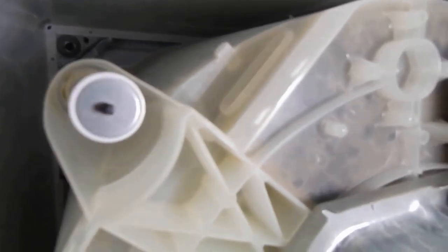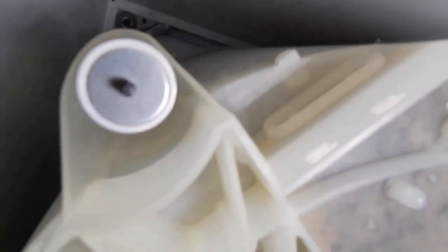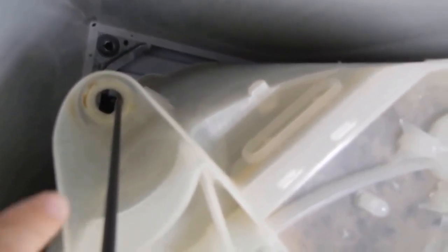I'm going to take this washing machine and just tilt it backwards and get up under it, and I'll show you what it looks like from underneath. Up under the washing machine here, on one corner, the one I'm taking loose — you'll see this spring right here. It just drops down, and you just take the spring completely out. This right in here is where it seats. So whenever you put that back up in here, you're going to have this on all four corners of your tub.